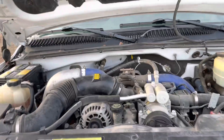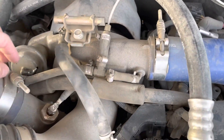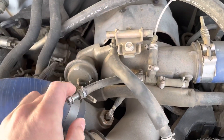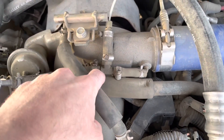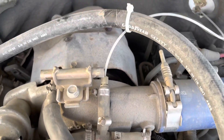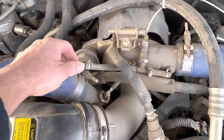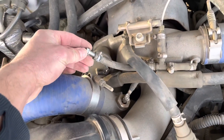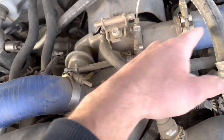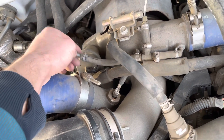In a 2001 to a 2004 LB7 Duramax. I'll start here under the hood. The simplest way to do this is to take this little hose that connects to the wastegate for the turbo, and somewhere in between it install a little fitting — then you've got your pressure line for the boost gauge. Put it through the firewall. Also, if you want a little more boost, just put a bolt in this end of the hose like I did. It still reads accurate, everything's fine, but that way your actuator won't open at all and you will have max boost.